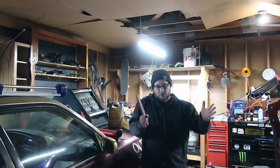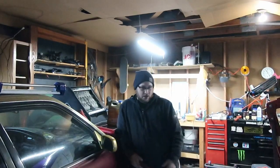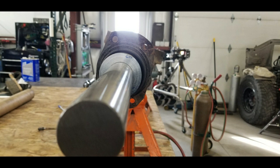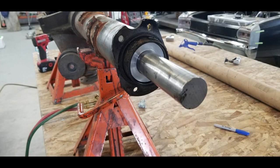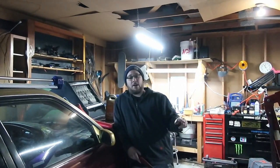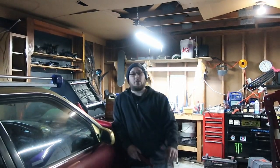So that'll shorten it up, and then you use your passenger-side axle on the driver's side. After you do that, there are tons of shops that have jigs that perfectly line the axle up — I'll plug in a couple of pictures showing what that looks like. Then you're going to take it, weld on your brackets. Like I mentioned in my previous video, I have all Techno Toy Tuning brackets, and then you're going to want to cut off the little excess things I've already shown.